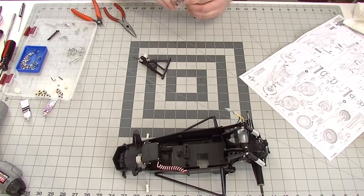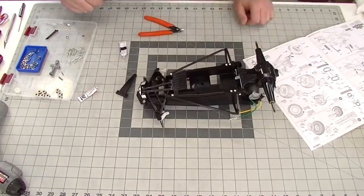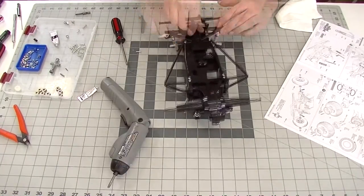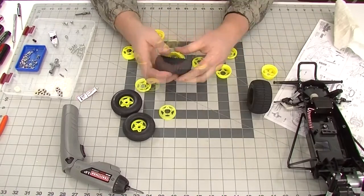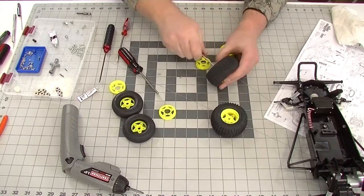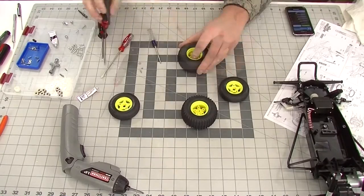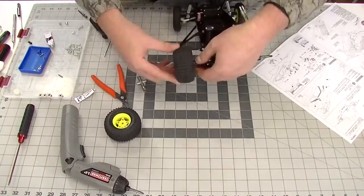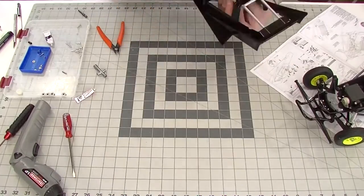So really, the only thing you need to put a bigger motor in this car is, I think, an 18-tooth, 32-pitch pinion, which there are several brands that sell, Traxxas, Robinson, probably Team Losi and others, so you don't need just a Tamiya pinion. But overall, this was a very fun build. It was enjoyable to just spend a Sunday morning and build this car. I just wish that I had tried the other settings. I thought 5 seconds would be adequate, but there's always next time.